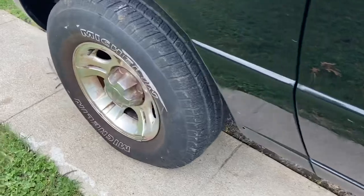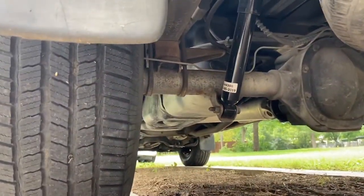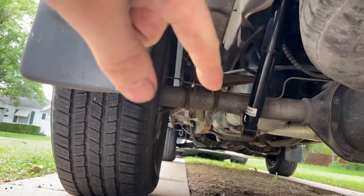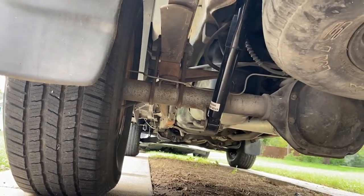It's getting pretty close to roadworthy, and I don't want it looking more in disrepair than it actually is. My point: you want to jack it up on one side, take the tire off, kind of like we did the brake rotors on the front. Take the tire off, work on those drums. And if you check out this picture,